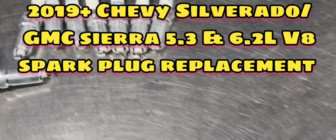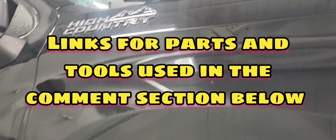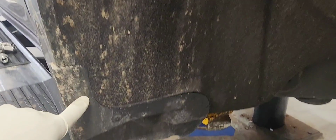Let's replace the spark plug on this 2019 Chevy Silverado with a 6.2. It is the same procedure on a lot of GM trucks and SUVs: Tahoe, Suburban, Sierra, and Yukon. So the first step is we're gonna remove the tire on both sides so we can access the spark plugs.